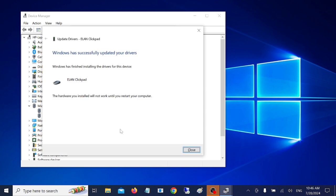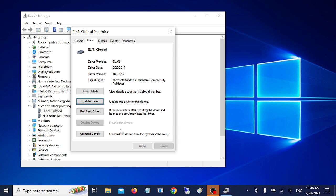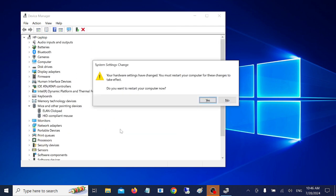Use the Tab key to close the window. If you had recently updated the driver and it's not working, you can also roll back to the previous driver. When prompted to restart, press Enter, then press S, and check if the touchpad is working. If the issue was driver-related, this will instantly fix it.